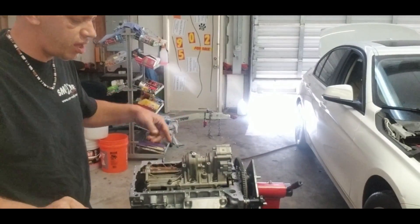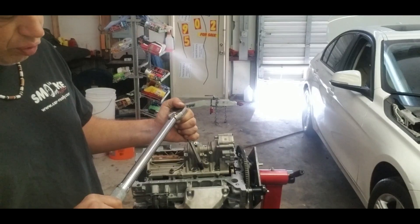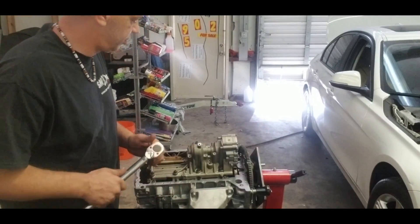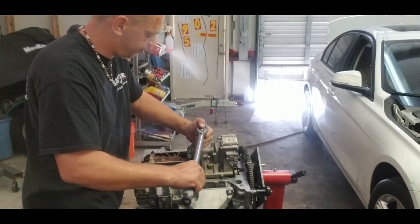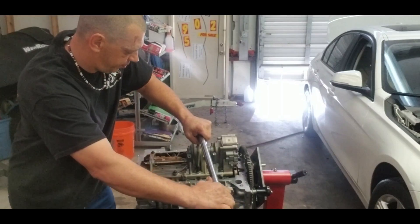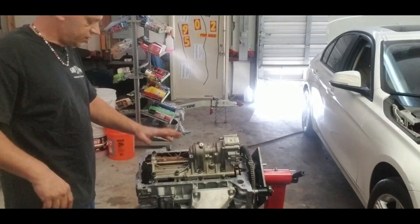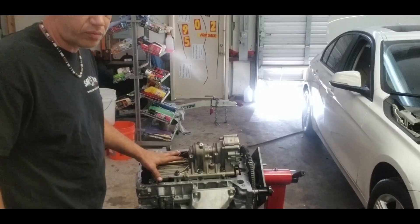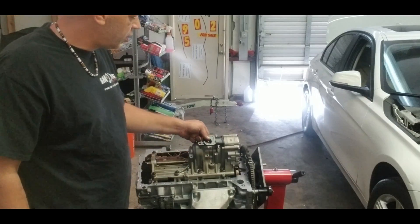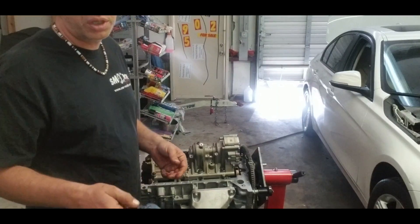Okay, let's torque it down — it's a 19 millimeter. Right now we need 90 degrees, so let's start on this one and do 90 degrees. That one is torqued down. The oil pickup tube filter — I didn't put it in yet because we need to do something here, and this one also needs to be cleaned.